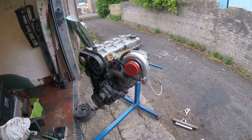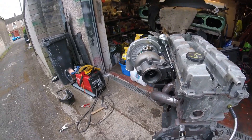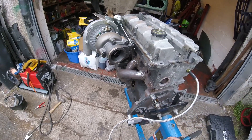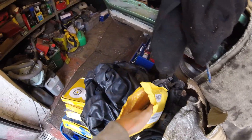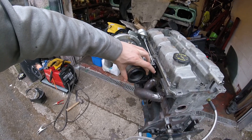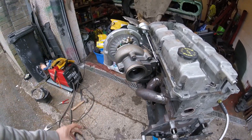That's about where I am so far. Got to wait for a few things — post is delayed and it's taken an age. The main thing is to get the turbo finished: I need to finish welding under here to hold the flange onto the pipe, then get a downpipe going. Unfortunately the V-flange that came with it is a two and a half inch, and my exhaust is a two inch. I paid a lot of money for that exhaust a couple of years ago so I'm going to reduce from two and a half down to two inch. I'm not going for mega power, so two inch will have to do.